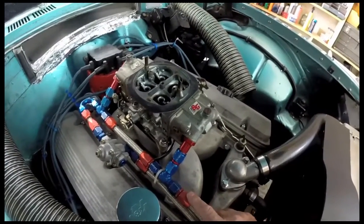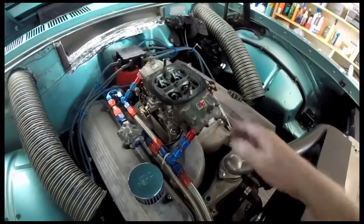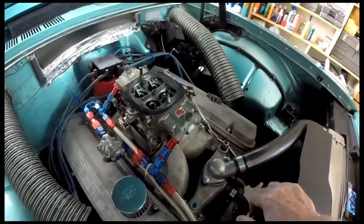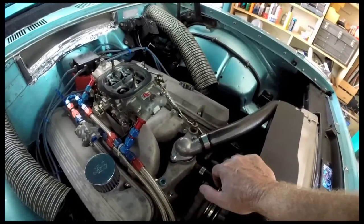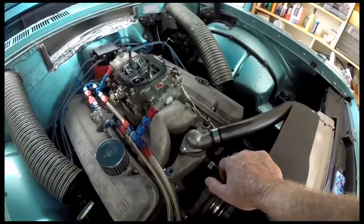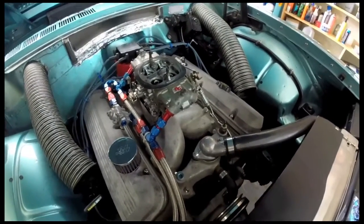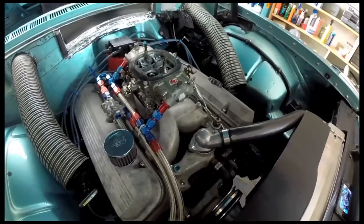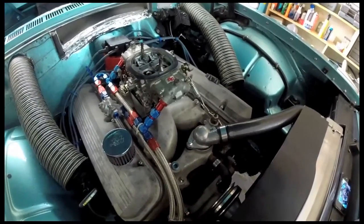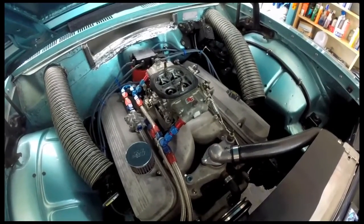With the return line on the fuel, you can just actually feel the cold on the carburetor. It stays so nice and cool. It's a solid lifter — a comp grind that we came up with. It's got about 245 to 248 degrees of duration in it, and the lift is .628. It works good. It's a lot like the old 288AR comp grind that I like.